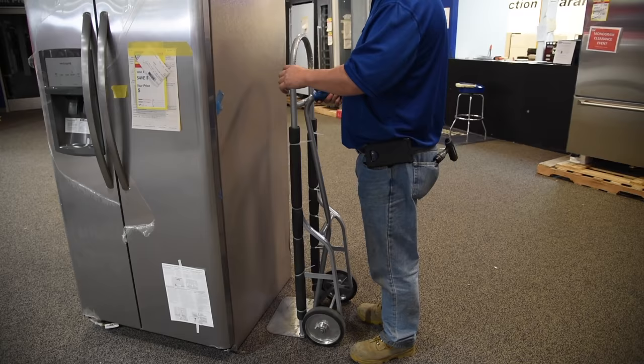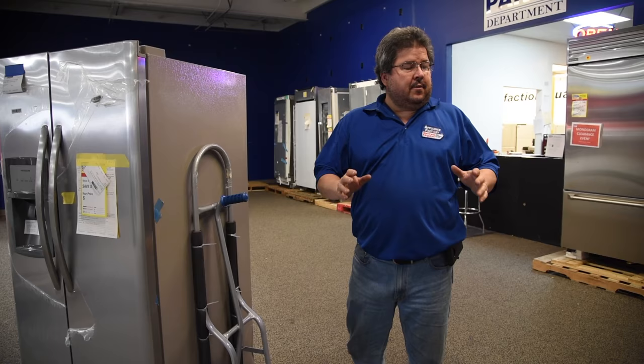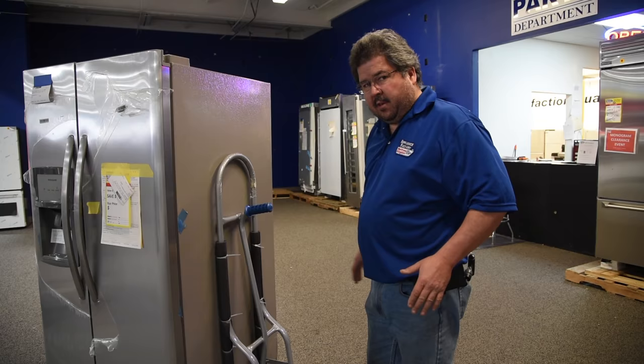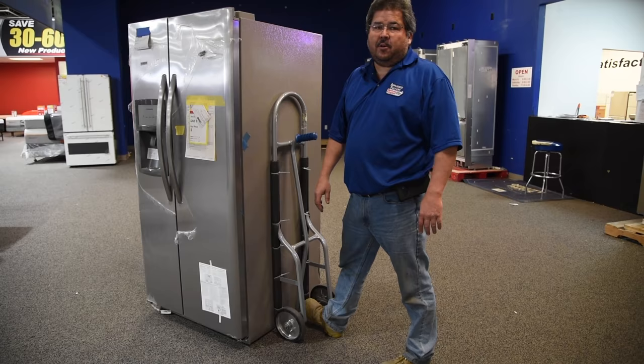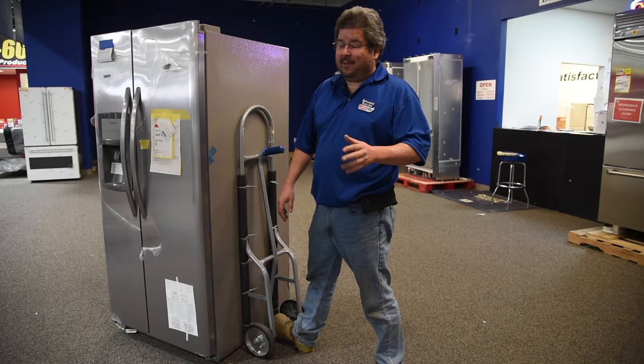What we're going to do is line up the fridge. Push a little bit forward using your other foot, slide it in place. Now, the more you do this, the more you realize center of the fridge is not center of gravity. The center of gravity is different from fridge to fridge — you will need to find that out. Once you've found what you think is center, brace your dolly with your foot. You're going to want to make sure you have steel-toed boots on. If you drop a fridge on your toes, you'll have pancakes, not toes.